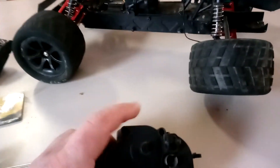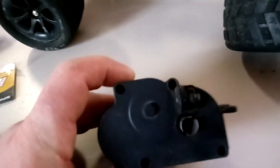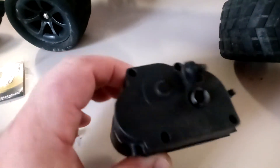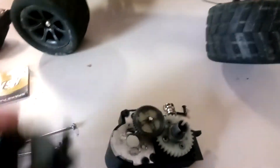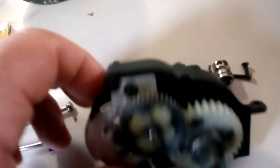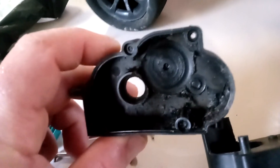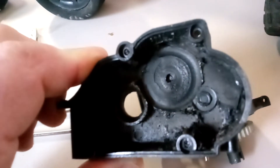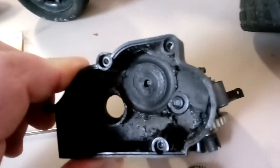After my last run of this vehicle, the gearbox — I could tell something was off. So I took a look, and just from looking you can see there's kind of a ring, which it's typically going to be flat, so that should not be there. I noticed that and I'm like, oh crap — and I felt it, it was hot. You can see the gear is not all the way chewed up, but what's happening is that with the speeds the motor and setup create, it creates a lot of temperature. And over time, due to the poor design of this, if you're going to run power in this thing, you're going to end up with this.